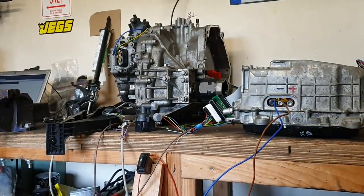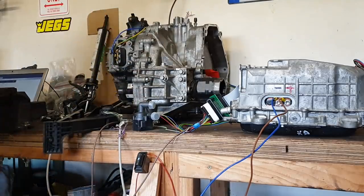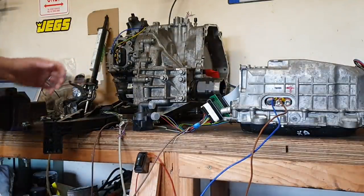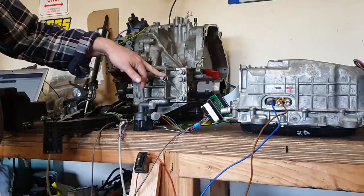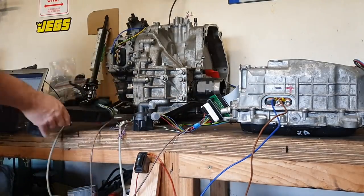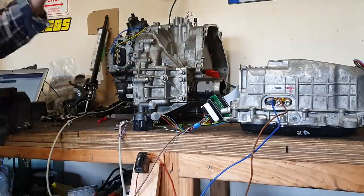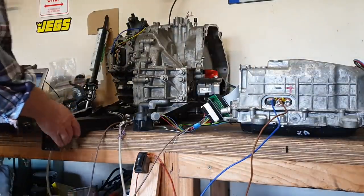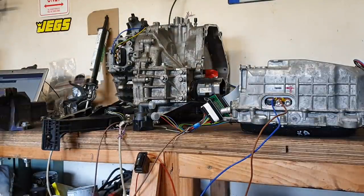Okay, so Gen 3 transaxle. And this is, I think, a Yaris inverter. We're hooked into MG2 in this again. And just to be super clear, this has the welded power split device in it also, just like our Gen 2 system. But because we have lubricating oil in this, we can spin it up. So this is forwards. And we can regen, accelerate. Regen. So that is with field weakening functioning also.